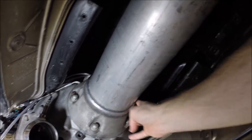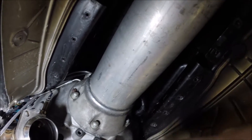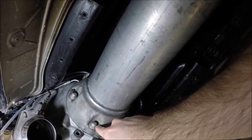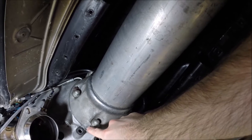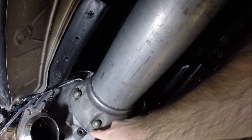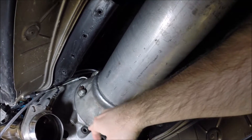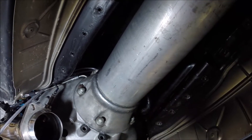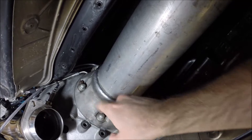You've got the five bolts here — these get put in at 37 foot-pounds. Be careful using the bolts; sometimes it can be tempting when you're still a couple inches out to use the bolts to help draw the torque tube assembly in. If it's putting up too much resistance, that's probably an indication that things aren't lined up quite right. Using the bolts to force the torque tube in can end up damaging the clutch disc, the pilot bearing, or the end of the input shaft inside the torque tube. If things aren't sliding together easily, it's a sign things aren't lined up correctly.